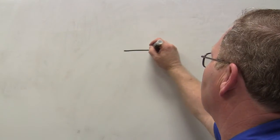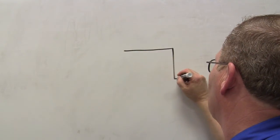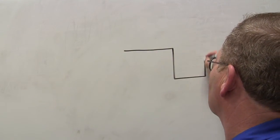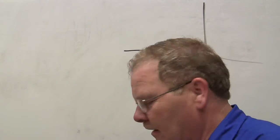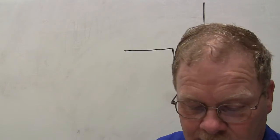When looking at a solenoid with an oscilloscope, what event often follows applying or removing power from the coil windings? This is basically talking about the injector. You're reading the side that triggers the injector. When it's pulled to ground, this is how long it stays to ground. When you release it, you get this. That's a spike, a voltage spike. About 50 volts is what it is.